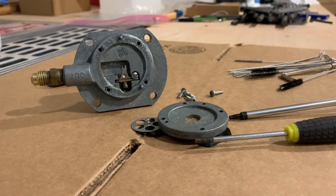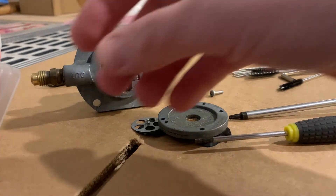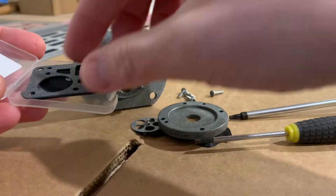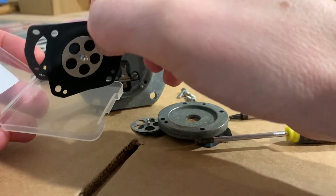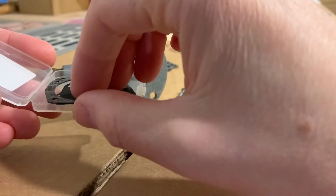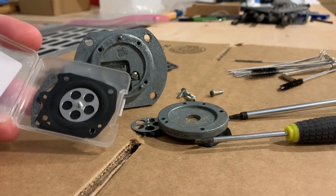I looked around quite a lot to see if I could find a rebuild kit for this regulator, and I really couldn't find one specified for it, so I started looking at other things Tillotson had made. It looked like there's a chainsaw carburetor — a DG5HS — that looks like a really close match. I was able to get a rebuild kit for that one for about $5. We only need the gasket and the diaphragm, and they look to be an exact match. I'll add a link in the description, but if anyone's interested in rebuilding the diaphragm for their Teleflex MBU V3, it's really simple and inexpensive to do.